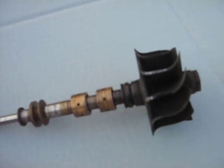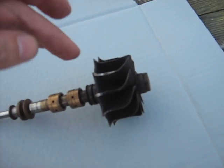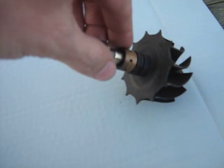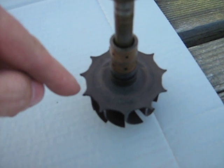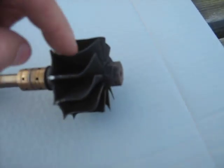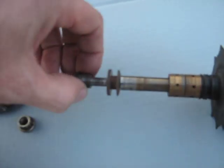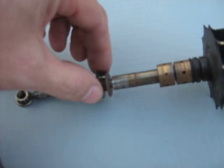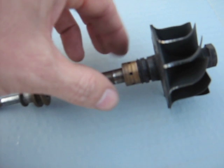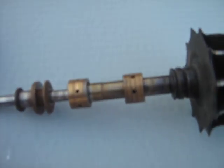Once the nut came off, the turbine freewheeled in the housing and launched itself. The exhaust then sealed the hole so the only place engine exhaust could escape was around here, and that ground the blades off in the process, as you can see.